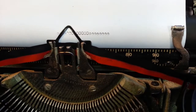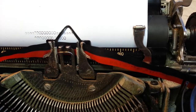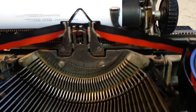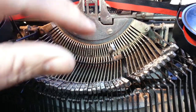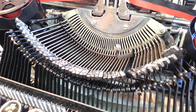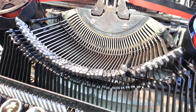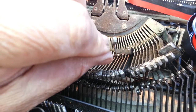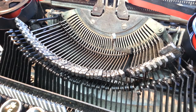It starts working when you do capitals. And then lowercase will work initially until you type on it a little bit. Right away I noticed the typeface has a broken solder joint. It's hard to see but there's a small crack right there. So when I hit capital O, it actually pushes it back together. You can't see the gap now. It's just shifting — the joint is broken.